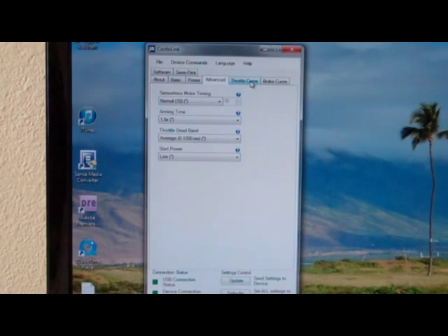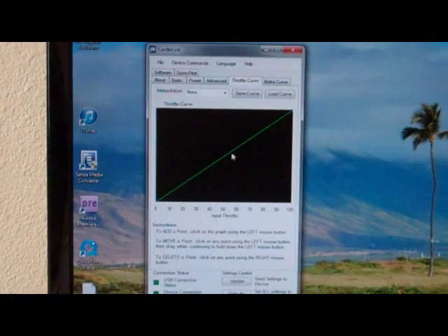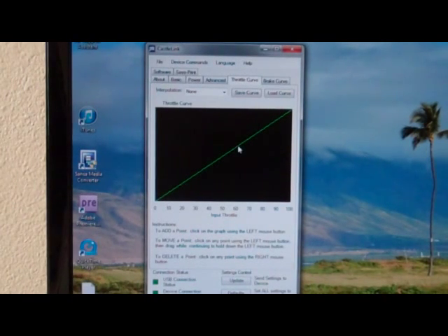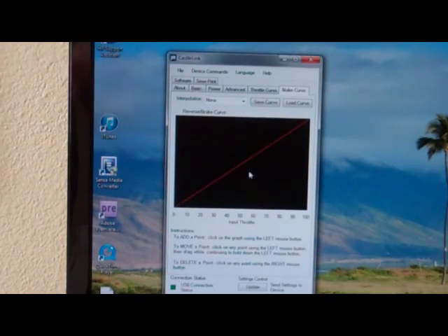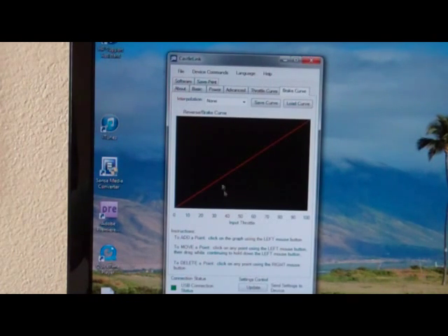Some of the advanced settings right here — now for my favorite part: the throttle curve. On this one I'm finding that as I pull the throttle on the remote it's a really long pull, so I'm getting a lot of power really far in. What I want to do is move that a little bit closer in, so I'm going to click and drag it up just a little bit. That will give me a little bit of power earlier on, and I'm going to save the curve. Same thing for brakes — if you want a really linear braking pattern, this is it right here. You can also set a dead band and a lot of personal preference there.